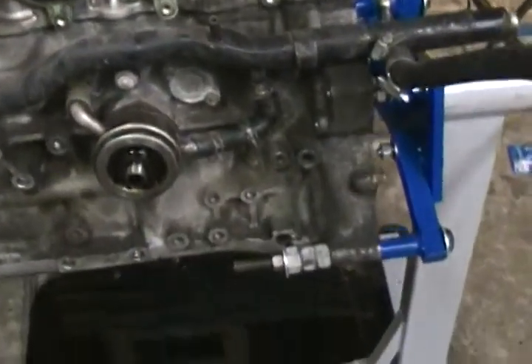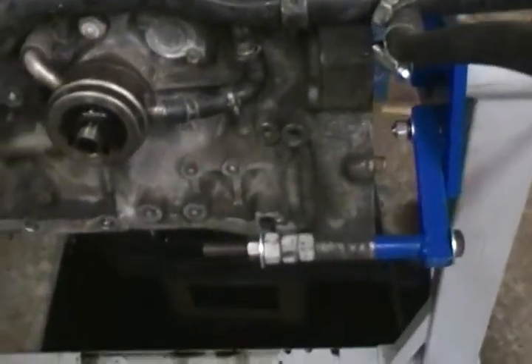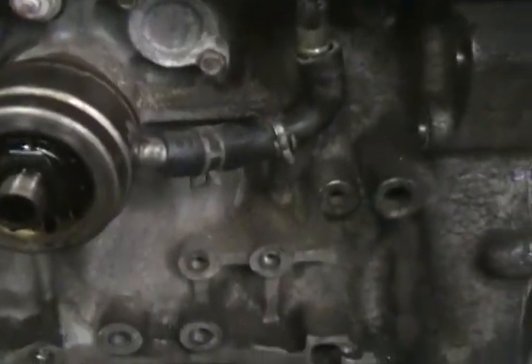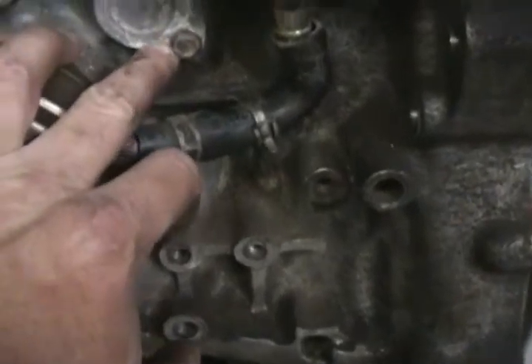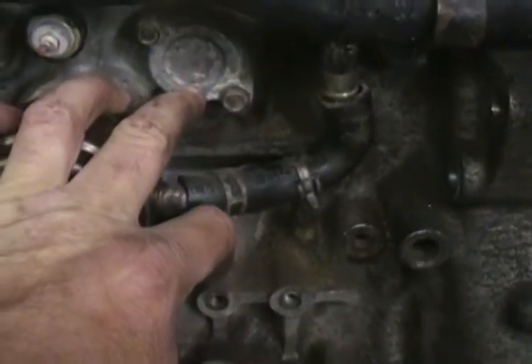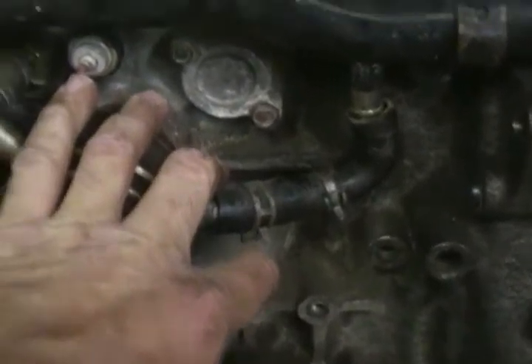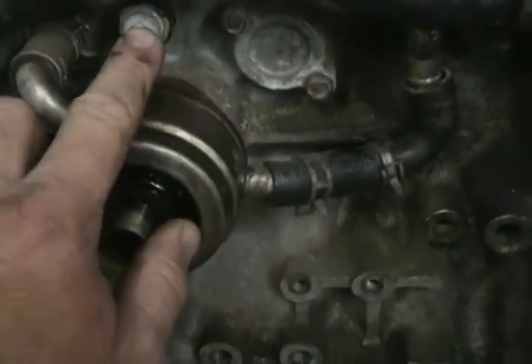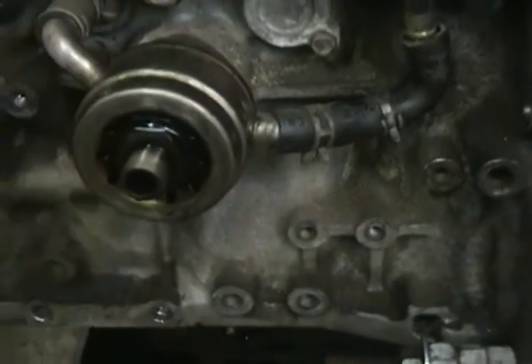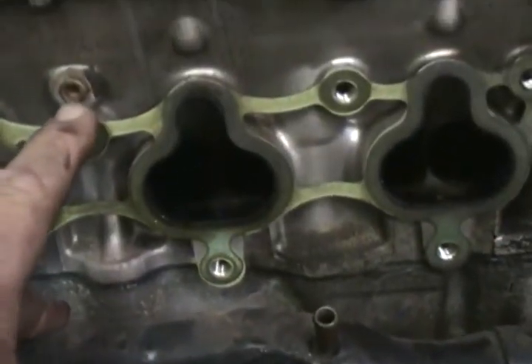The reason I'm making this video: I want you to remember to pay close attention to everything you're doing — everything that needs to be removed from the old motor. You see this little plate right here? This is like a core plate. Behind there is just the water jacket. Here's your oil temp sending unit right here. Here's an oil cooler and a line going into the block. Right up here is a core plug.